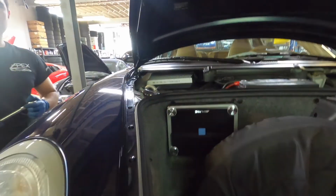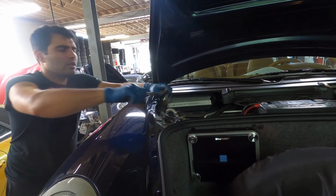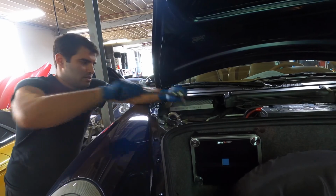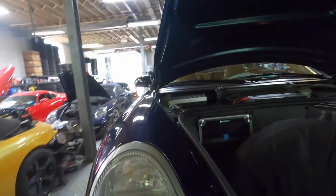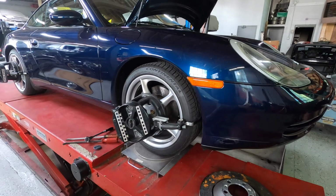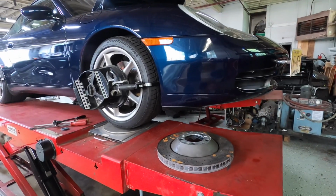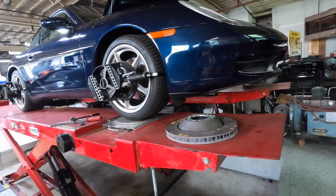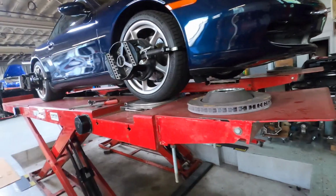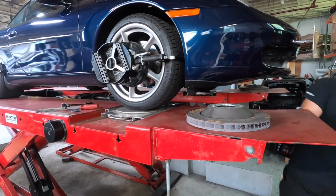Cool that it comes like that from the factory. It gives you a little bit of adjustability, you know? Yeah. However, I just blindly did it because I maxed it out. But when you do these cars, you need the machine to get it right. That little adjustment will help the tire tread on the outside. It's going to help the tire wear on the outside, but it's going to give you a lot more ability to turn it. Your car after this change feels significantly different to you. Yeah. Won't feel as loose? Yeah. I can feel it even at higher speeds.